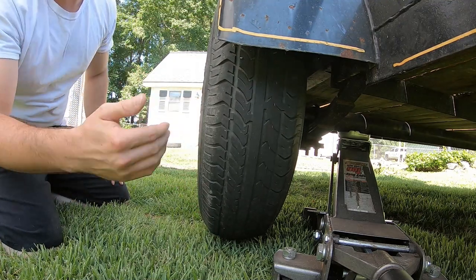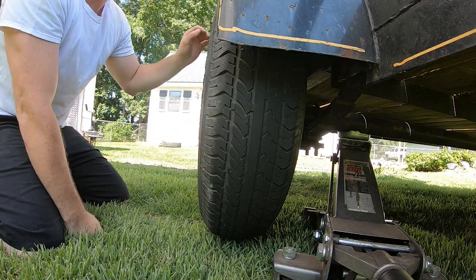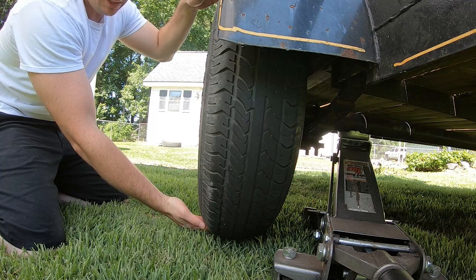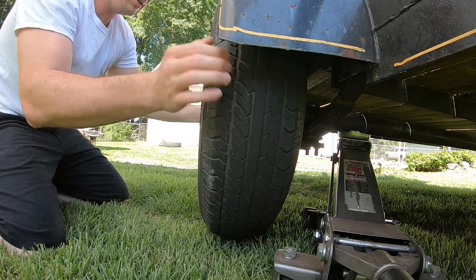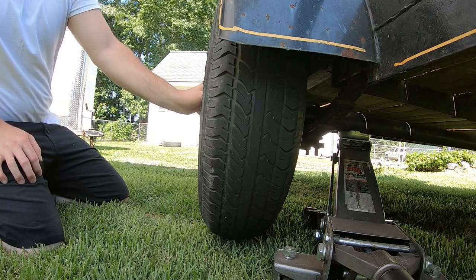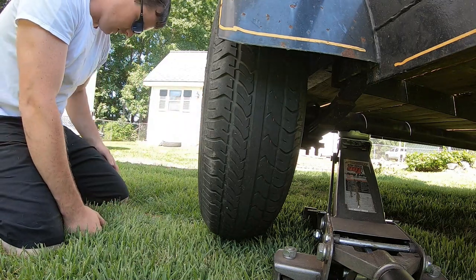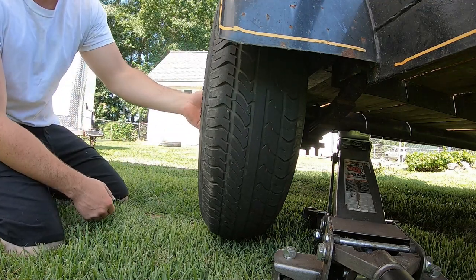That could have to do with the way it's wearing. When you're going down the road, you can look in your rearview mirror and see this outer wall has a little bit of wave to it - about an eighth of an inch from top to bottom over a 15-inch rim, so probably 18 to 20 inches total with the tire. An eighth of an inch over that distance isn't too bad on the bearing, but it looks like it's wearing the tire out pretty good. So today we're going to be resetting the preload on this. We'll pull it off and check for any gouges in the spindle.